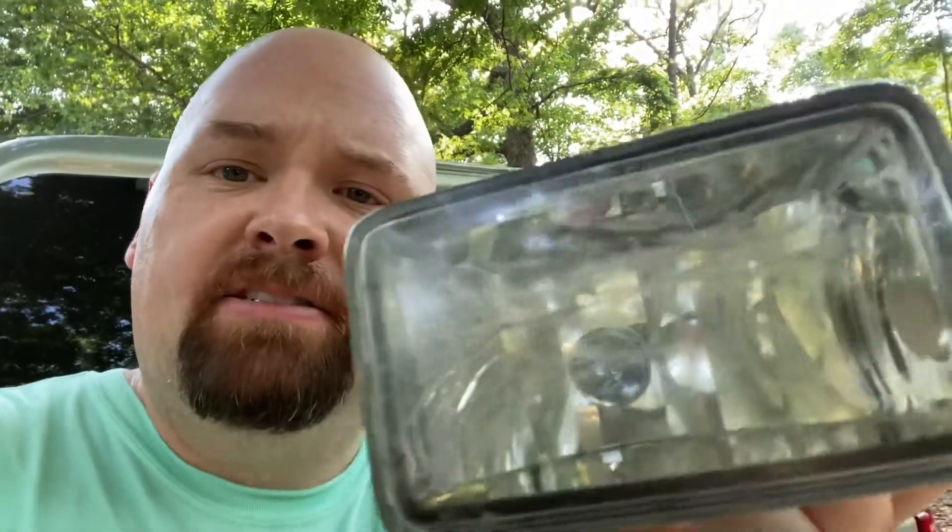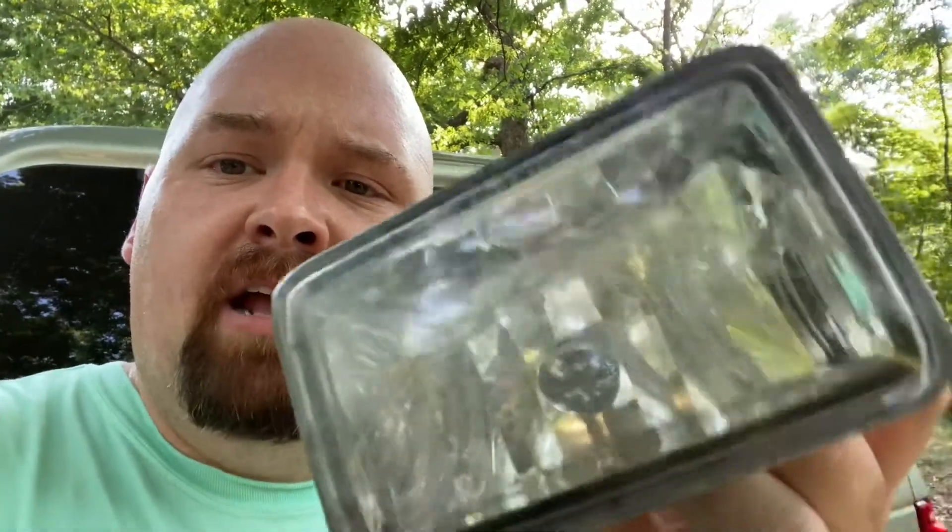But another reason — this is what happens to just about every 13th generation F-150 from the year 2015 all the way to 2020. These lights get so hot from the halogen bulbs that they scar and mar the lenses on the fog light housing, and they look like this.